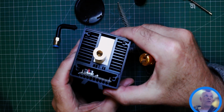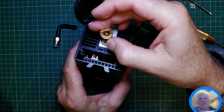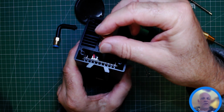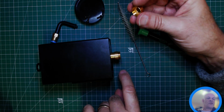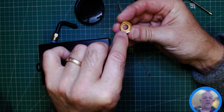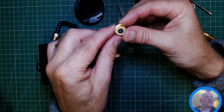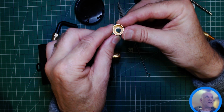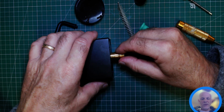So this has now revealed the smoke guard. This thing will actually come off. Be careful when you're taking this off, because now you're revealing the lens. What I recommend is, once it's off, tilt that down so no airborne dust will get in there. Now you shouldn't get any dirt inside the lens, so there's no real point in taking it off. You can leave it installed, and you can see the light reflecting on the glass, and that is a glass with some anti-reflective coating on it for the laser to pass through. So I'm just going to screw that back on.